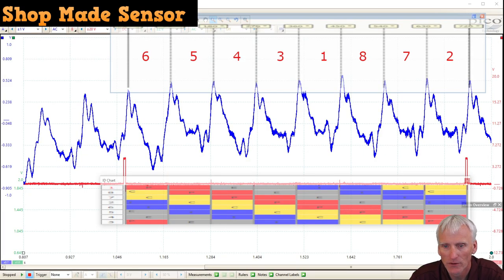So one thing to remember, that there's nothing wrong with this Silverado that we're testing right here. This is just kind of a baseline. And you can see this doesn't look that much different from the running compression or the running pulse test that we did. The pattern maybe looks a little more jagged, but you got to remember that there's very little intake manifold vacuum. So it's probably picking up a lot more of the irregularities that are going on. Obviously, if we had an intake valve issue, we would probably see that show up very well in this pattern.